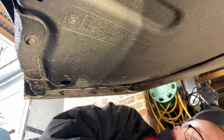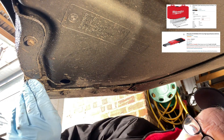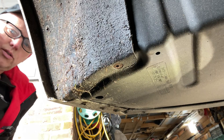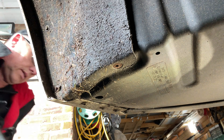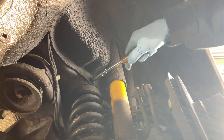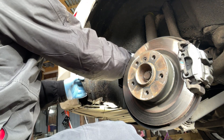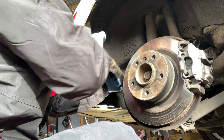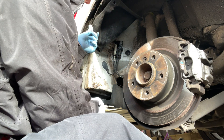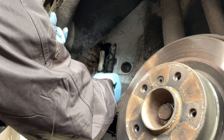To replace the sensor we've got these bolts to remove — 8 millimeter. I've got the M12 Milwaukee ratchet which makes light work of this, soon whizzes those bolts out. A quick prod gets the stuck ones out. We've also got a couple of 10 mil bolts and a quick-release threaded bolt. We lift it all out of the way, and there's the ABS connector plug up here — I've got one for the brake pad warning and one for the ABS — let's pull that out.